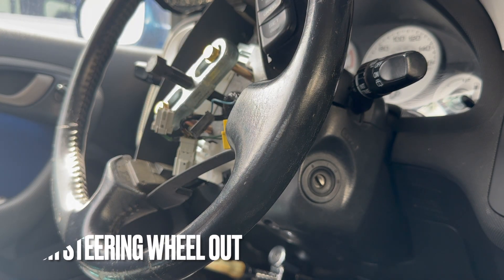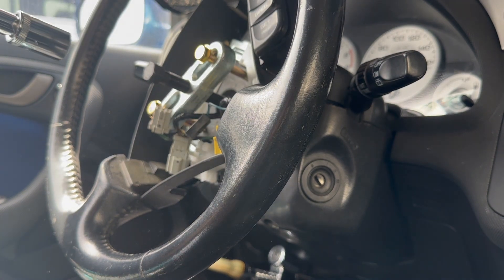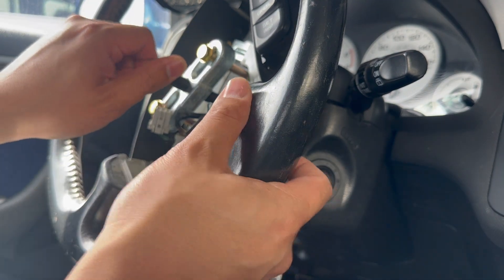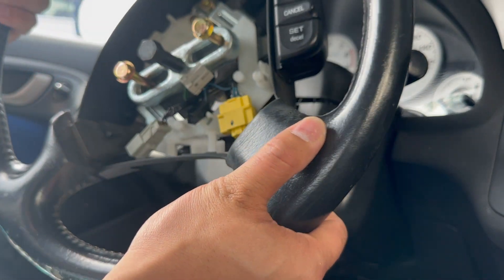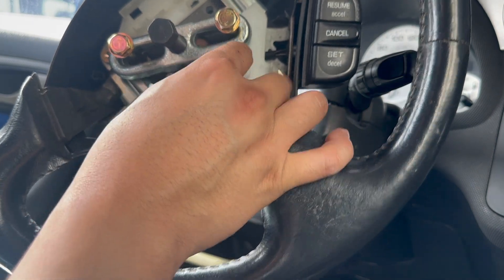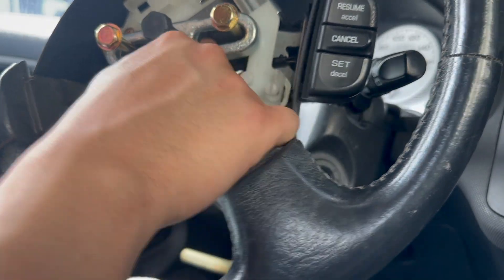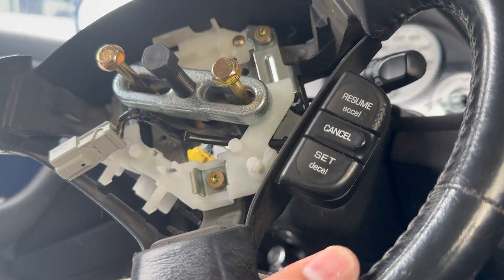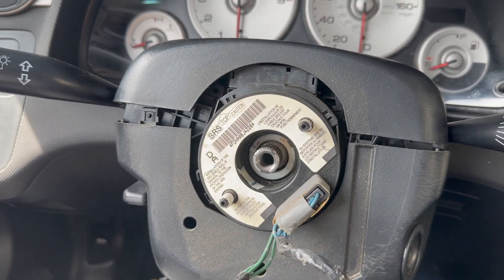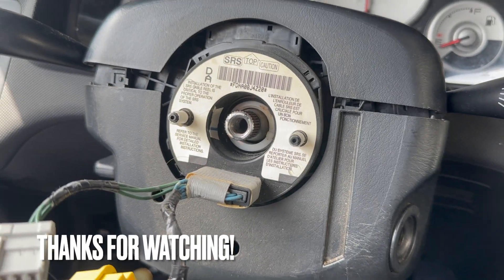We're just going to start spinning — I'll close the door. It's really hot, and — it just popped! Look at that, it's all loose, we got it out. Now just maneuver the wires out of it. Take the yellow safety clip out first, back out the other gray clips, and there it is — the steering wheel is disconnected. I'm going to do a little magic with the cover, and when we install it we'll clean up all this dirt sitting behind here. More on that to come.